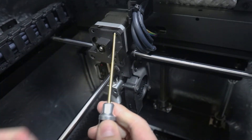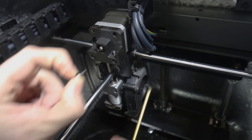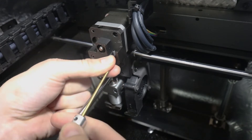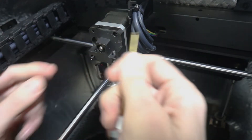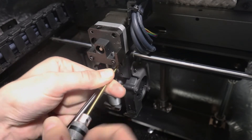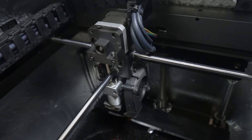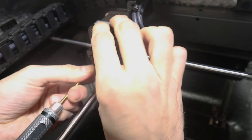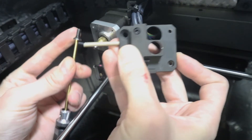Set that to the side, then use the 2.5 millimeter to get the three screws holding on the face plate — there's one and two longer screws on the bottom. Those longer ones you can actually leave in there since they're secure and won't fall out. And number three. For this one we're going to take off the two bottom screws, which are 3 millimeter screws. Pull those out — you can tell they're different because they've got that angle on them. This takes the whole face plate off the machine.